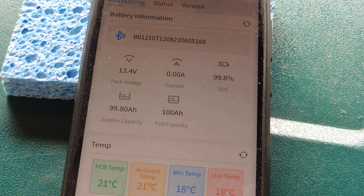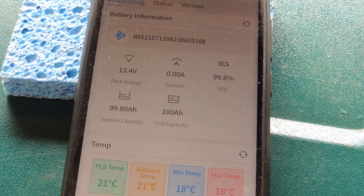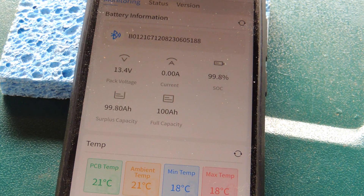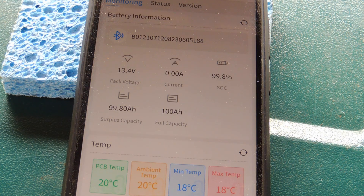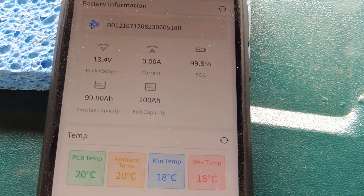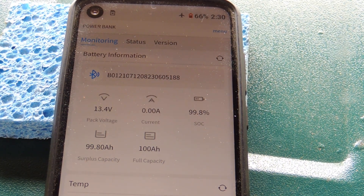This app is the reason I chose this particular battery over another brand — I wanted to be able to see what it was doing and show you guys too, because I can't be the only one with questions. We're still at zero amps, so either we burned out the converter or the BMS has shut down. Will it even get to 100%? They say it won't because you need an AGM or lithium charger. In the last video I got it to 100% with the AGM charger, but maybe 99.8% is all it's going to get. That's fine — 99 amp-hours is a hell of a lot better than the 40 I was getting out of those other two batteries combined.